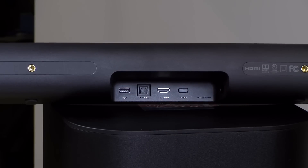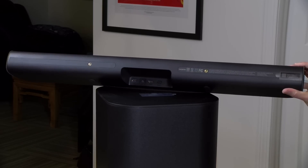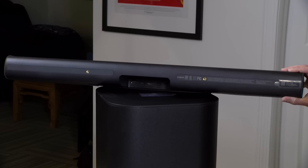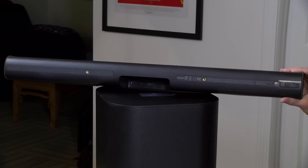There's also a USB port, and you can use this for playing back your own media files. You could take a USB hard drive or USB stick and play lossless FLAC audio, MP3 files — all the popular audio formats are supported. It also supports H.264 and H.265 video, so if you have video shot with your phone or a camcorder, you can play that through the USB port. I am disappointed that it doesn't include an Ethernet jack, because it does support 4K video and streaming services are pushing a good amount of bandwidth to deliver that. This is Wi-Fi only, but it does have support for wireless AC, so at least you'll get the faster wireless speeds. And since it's likely sitting out in the open rather than behind your TV, you'll probably get a better signal — but having an Ethernet option would have been nice.